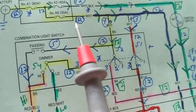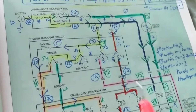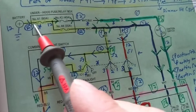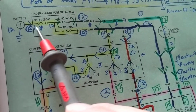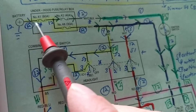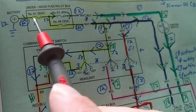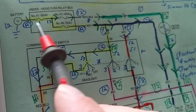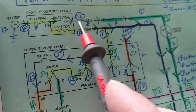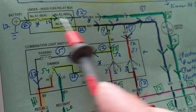With that rule in mind, let's try to understand the voltage drops and voltage points, references. We know 12 volts is our battery. At one side of this fuse number 41, it's 12 volts because it goes through a wire. Our rule just said we don't lose any voltage - 12 volts here, 12 volts here. We don't lose any voltage across a low resistance fuse. Going over here, 12 volts - because we should not lose any voltage through this wire and through this fuse. So far, 12 volts. We didn't lose anything.